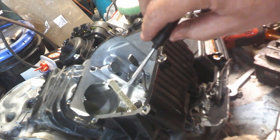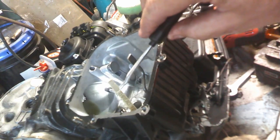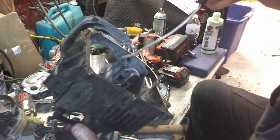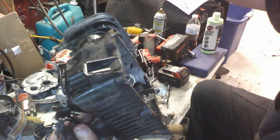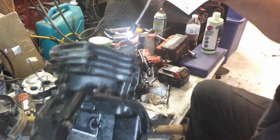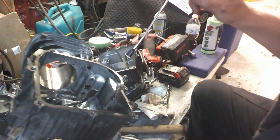And you see how that thing's been hitting right there, and I don't know if that's kind of a normal thing or if this is something that goes on, but let's look at that newer engine block that's got a hole in it. A little cutaway right there, if you can see it. And you can see that this one doesn't have near the scoring on it. It's kind of too bad because, you know, if that doggone hole wasn't in it right there, I'd be apt to reuse this cylinder. And I think this one probably would be good.